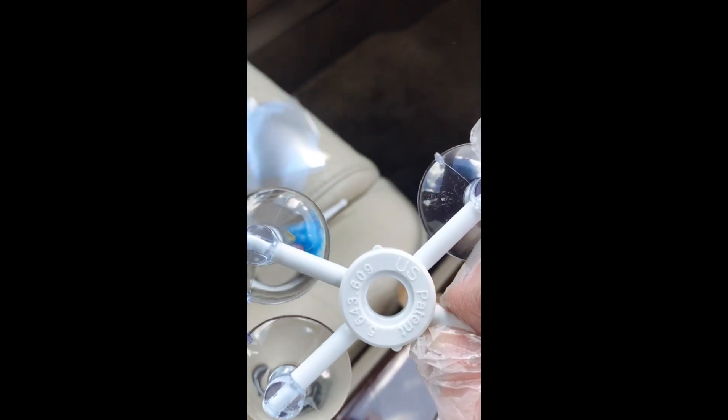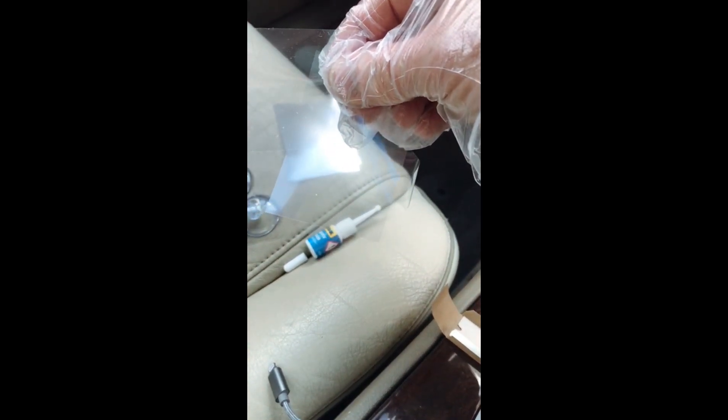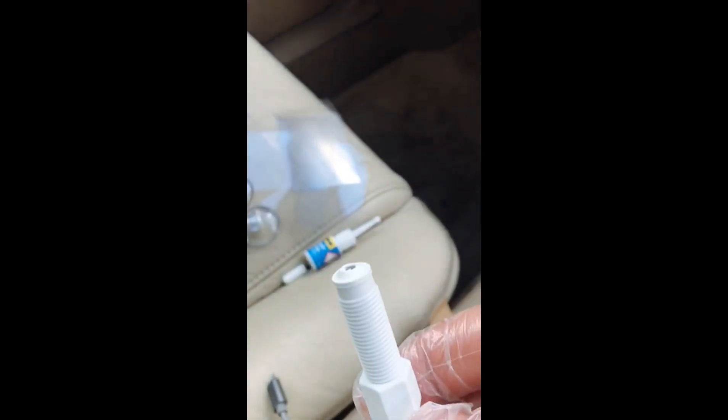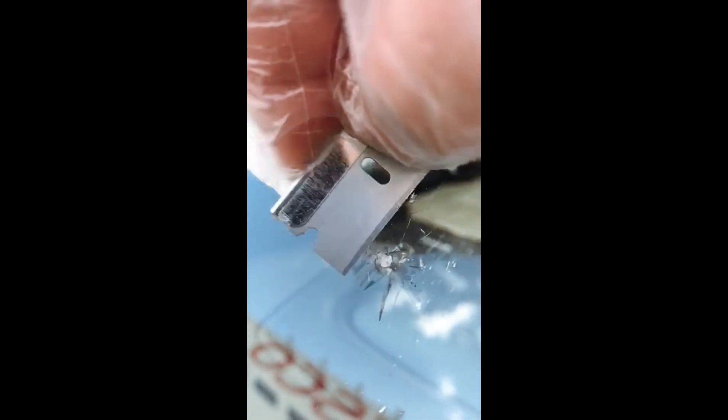This is what comes in the repair kit. I've got a razor blade — I'll show you what that's for in a moment. I've got these suction pads. This goes on the outside of the windscreen with the centre hole directly over the chip. You get this resin that sets hard, curing strips that are put on temporarily and removed after it's set, and this piece which screws into the top and pushes the resin into the crack. Here's the chip from the outside. Use the razor blade first to scrape away any excess shards of glass to make sure it's smooth — only on the actual crack itself, otherwise you'd scrape the rest of the glass.